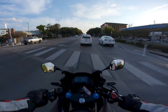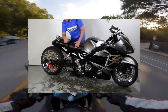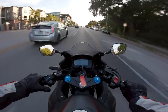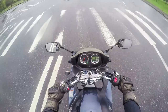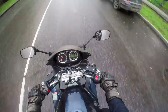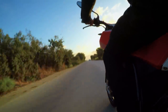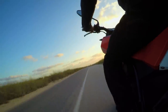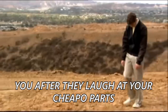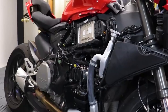Number seven: mods. It is possible to do real damage to your bike by doing dumb mods or using crappy parts. Something like popping a cheap $50 turbo from Amazon on your Busa will probably leave your highway monster a chunky paperweight. More realistically, using universal parts like levers, slip-ons, or lights — while they work on any bike in theory — in practice don't work well on anything: you'll get wiggle from your levers, your slip-on will leak, and your lights can short out. Look for parts specific to your bike instead. Also, when installing mods, do so cleanly and carefully — installing something incorrectly can strip bolts or damage other parts too.